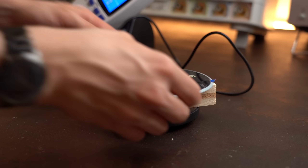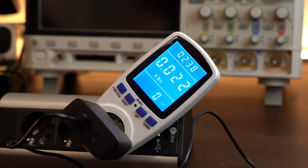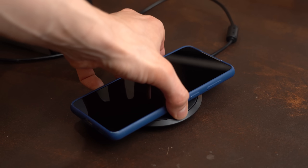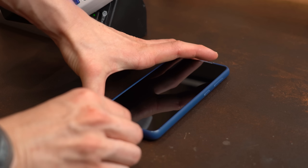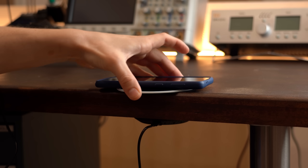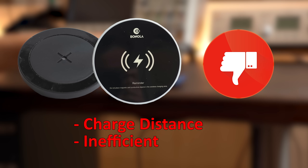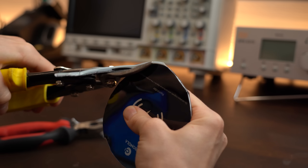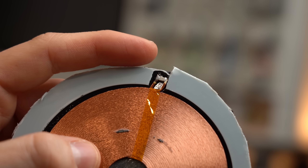Worst of all, while charging through the piece of wood with the given extension pads, my power supply required a total of 22Wh to get my phone from 50% to 100%. In comparison, my previously used wireless charger requires 18Wh for this job, and a normal USB-C cable only 11Wh. Meaning this long-distance charger not only breaks its description promises but is also quite inefficient — thumbs down from me. The only thing I found interesting was the construction of the extension pad, which is basically just a coil with an attached capacitor forming an LC resonant circuit.